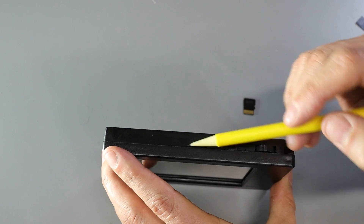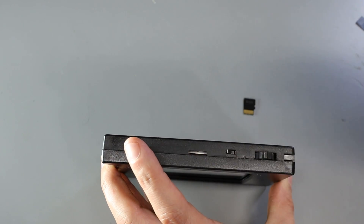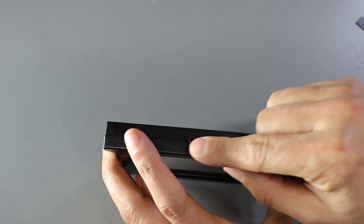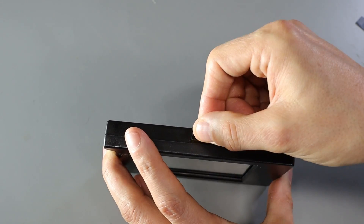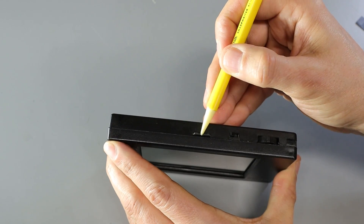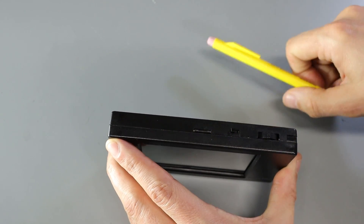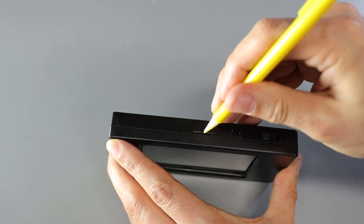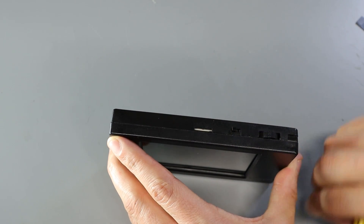Now that everything is reassembled, you can see the white strip there — it's visible, taking up all that extra space. If we bring in an SD card and try to put it in the wrong way, it obviously won't go. It'll only fit into the slot where it's supposed to go. These things are a little hard to click in with your finger because of the recess, so I always use a pencil — and you can see it's locked into place where it belongs. Now we can pop it out of there and go take our files off the Nano VNA. There you have it: a quick and easy way to dummy-proof the SD card slot on your Nano VNA. 73 if you're a ham — thanks for watching.